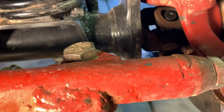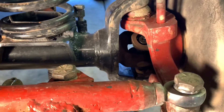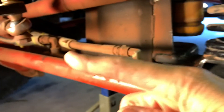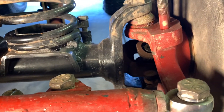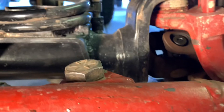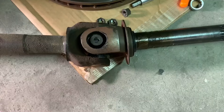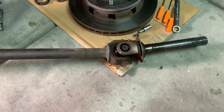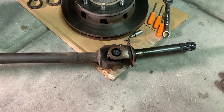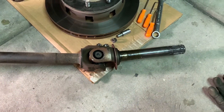We'll see what we did — I'll pull that apart. I've got a whole axle completely assembled; not sure if I'm going to use that. On that side I've got the chromoly stub — I think this is the standard one but it could be chromoly, I can't remember. Anyway, pulling it out. I remember when I put this one together I think I reused the U-joint, and maybe there was too much pressure and the clip came out.